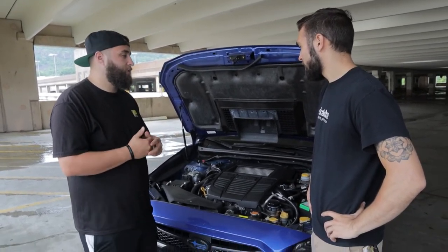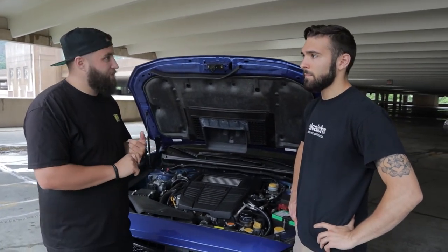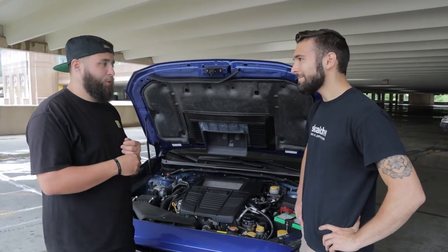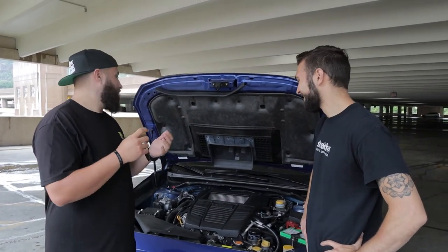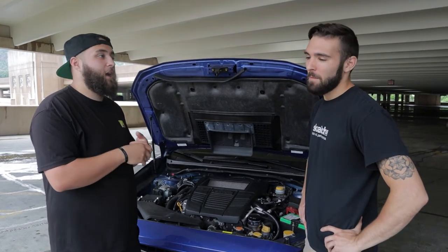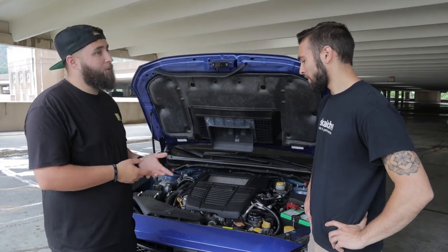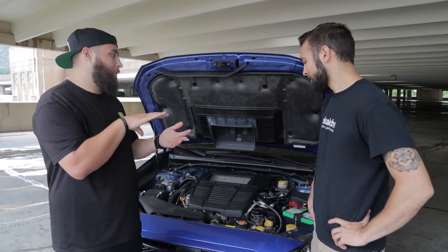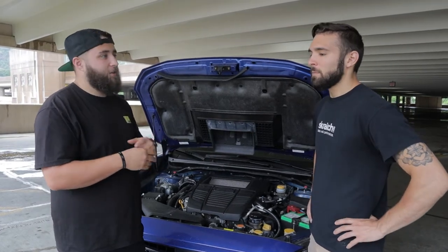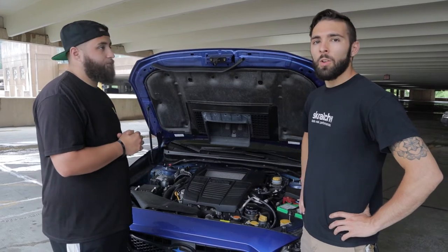Tune is the most important thing, and cooling is the core problem with these engines. Overheating is why you blow rings and why piston four goes - it's not the engine randomly deciding to fail. Same with a catless downpipe: boost creep leads to overboosting, the engine blows, and then people blame Subaru when it's actually their own fault. A boost controller gives you a much more accurate way to manage boost.